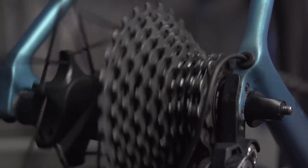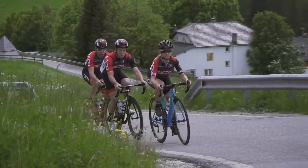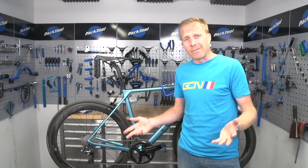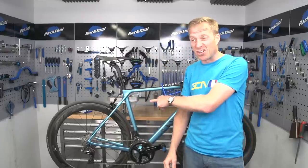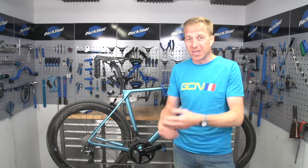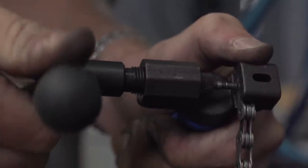Hence the love for a clean chain, because a clean chain means it's going to last a bit longer. A chain with excessive wear isn't going to give you good gear shifting, which is an essential part of bike riding. A worn chain won't sit perfectly on your cassette sprockets or chain rings, and in turn it's going to wear out those components a lot faster than normal, giving you more repairs to do and costing you more money.